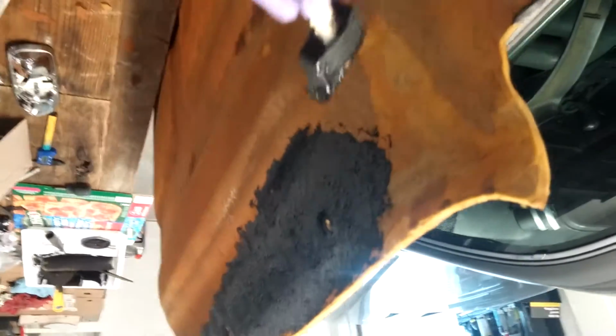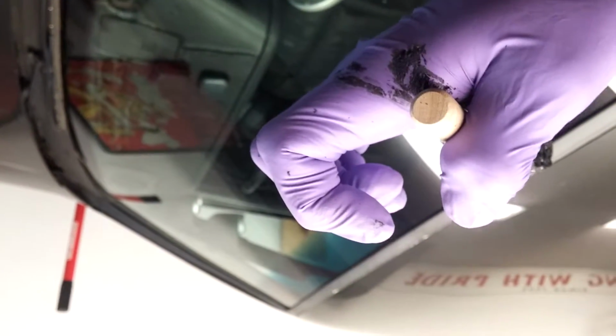All right, so I'm just about done my headliner. I've added a couple more little things. I'm going around right now and putting on a little bit of lip protection. So around the edges here, focus. There we go. At the corners, on the front and the back of the car, because there's no fabric, that lip usually goes around the edge and up top a little bit. There's going to be a little bit of exposed carbon fiber, especially at the back. You can notice it when it's in the car. So what I'm doing is going around and adding a bunch of extra bed liner along the edge, and I'm also doing it on the back just to help strengthen it.